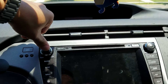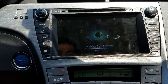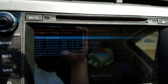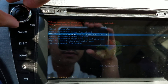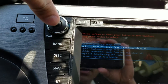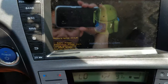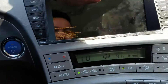...four, five — then you let go of the power button and push it again. Now you are in recovery mode. Once you're in there you can do update image and clear all. Go to SD card, click on that, hold on to this, and there you go. It's going to take a while — say about less than five minutes or so.